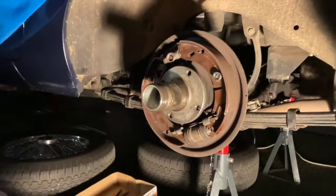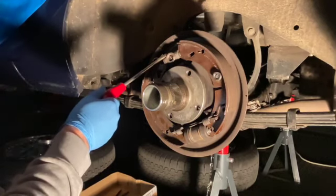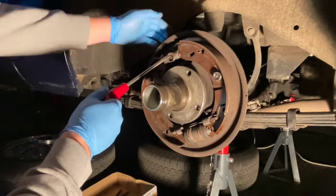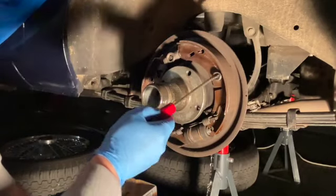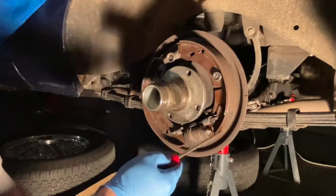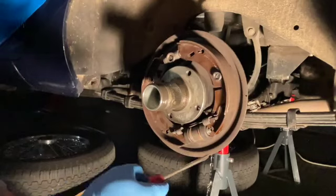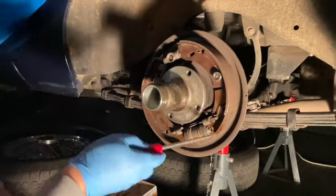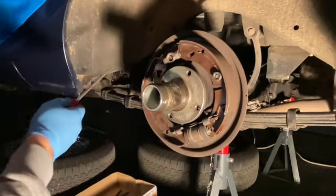Then you need to look at your interior. Okay, so here we've got the brake adjuster, and this has a screw through the middle that's adjusted by a screw on the back there. Your plates have a leading and a trailing edge. And the leading edge is this long, bare metal edge. The wheel rotates in that direction as you move forwards. That's your leading edge, not the short one. And both leading edges should be there, so it shouldn't be symmetrical. It should continue leading edge, leading edge.